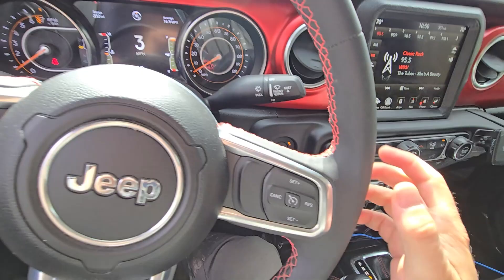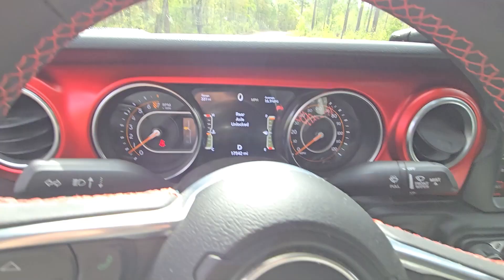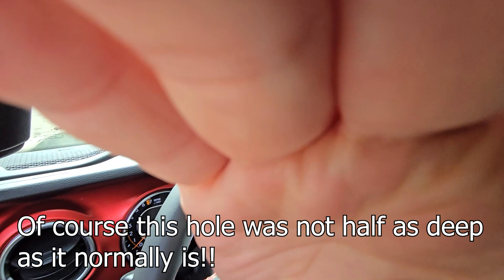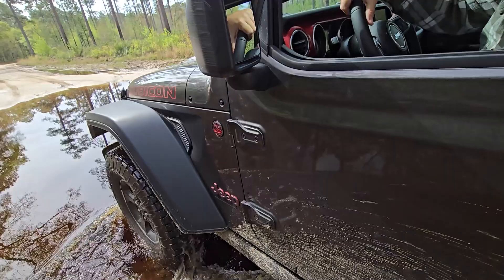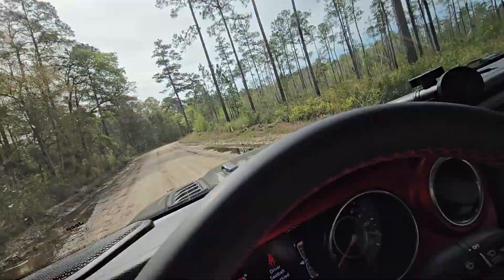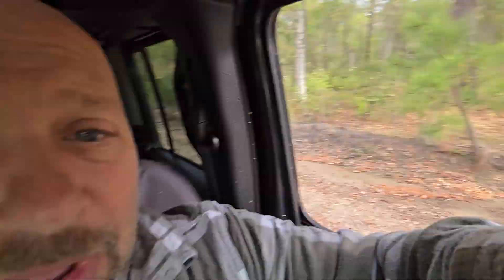With a domestic vehicle, if you wanted to, you could also hit the rear locker — now your rear axle is locked, giving you that extra wheel of traction. We don't need it so we'll turn it off — we are now unlocked but in four high. There's a pretty good little drop right in the middle where we're going to sink down. We're in four high so we can take our time, go slow through it, and we're climbing back out. Having that four-wheel drive gives us that confidence, and we made it through with no problem. Now we can simply go right back to two high.